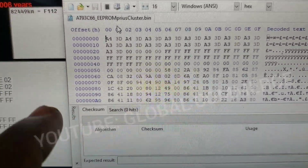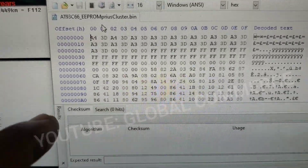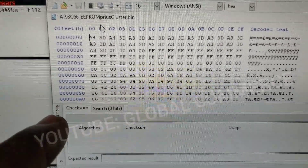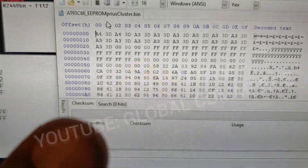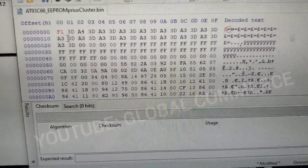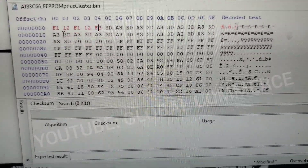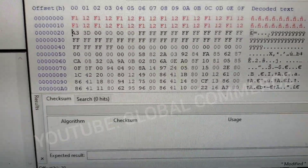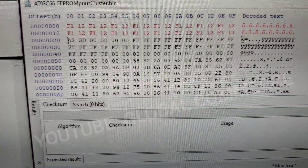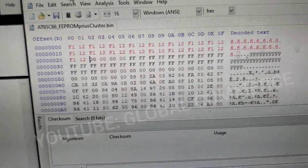The EE02 value we're going to modify to F112. With Caps Lock on, we put in F112 and replace all of the lines just like that — that's the flag for the mileage. We do that for each line and on the last line, line 20, we do it one final time. Then we save our file and call it 'cluster corrected.'